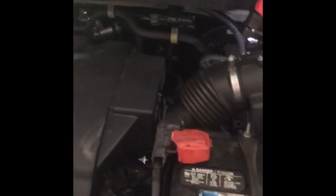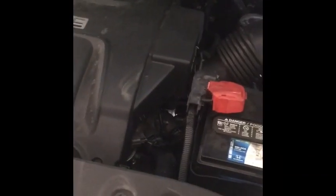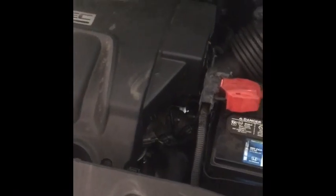And I'm gonna pull the fill plug. There is a washer on there, a crush washer. You may need to change it, may not. You'll need an extension and the proper size socket, which is 17 mil. Perhaps even a breaker bar. It is on there tight. Torque it with the breaker bar.